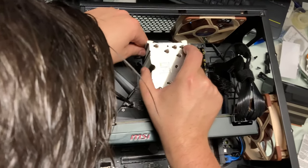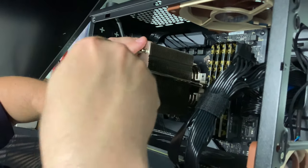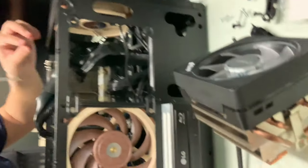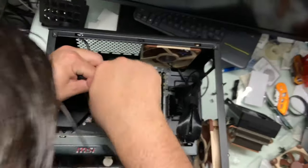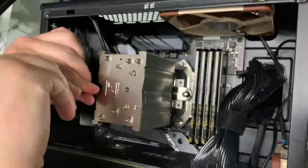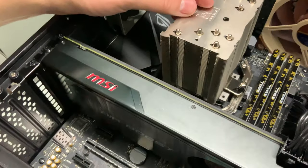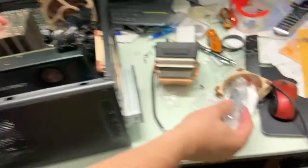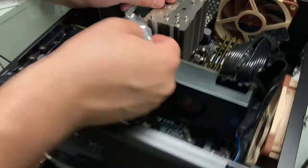Now we put the cooler on top. The cooler mounting hardware comes with these long screws. The ideal goal is to thread both sides so you have more of an even force when applying the cooler. What's really cool about these Noctua guys is they include all this extra mounting hardware. In the mounting kit they give you thermal paste, a Y-splitter, an extra adapter, and this little metal clip to attach an extra fan on the other side, so you could have more cooling performance by having air push through and giving you much cooler performance.